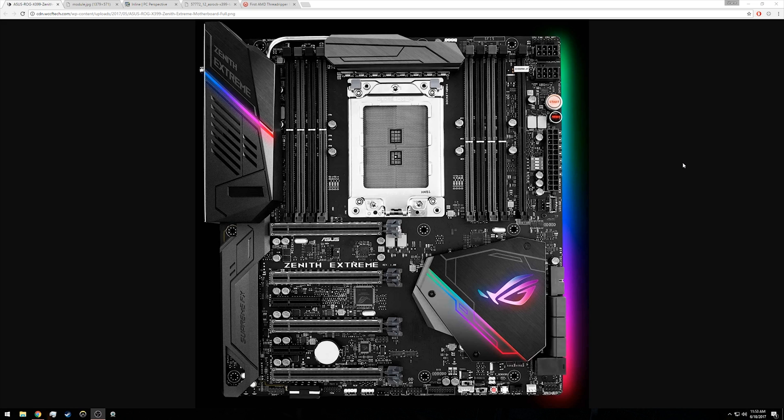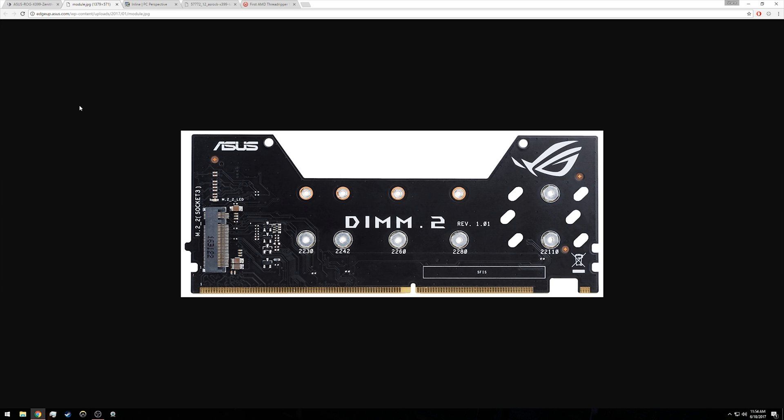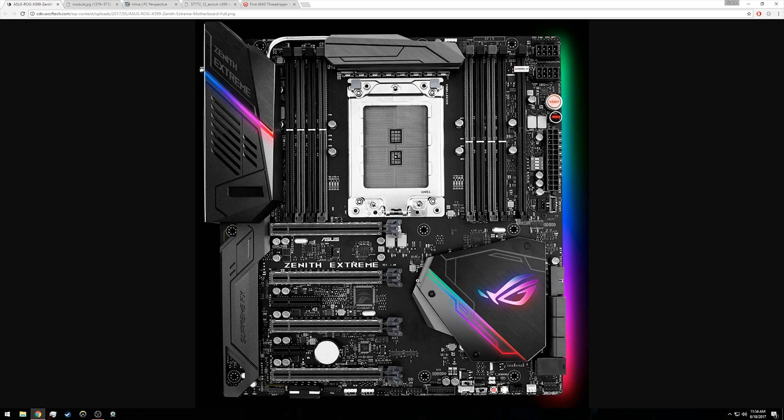This is an EATX motherboard and a few of the features include some RGB with a very neutral overall color scheme that should help with aesthetic compatibility for your build. It also features 8 DDR4 slots for your RAM featuring quad channel support for that Threadripper processor. Interestingly, there are no M.2 slots at least not on the front side of this motherboard. However there is a DIMM.2 slot, which is Asus giving you the option of inserting a riser card that you can attach M.2 NVMe drives to. The advantage of putting the card there saves some space on the motherboard itself, though being an EATX layout, Asus has plenty of motherboard real estate to work with.